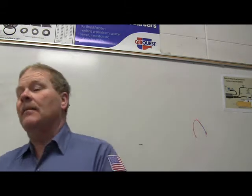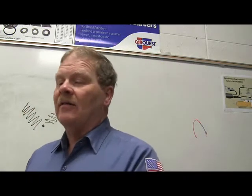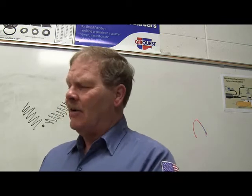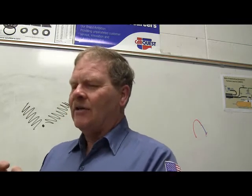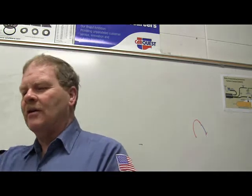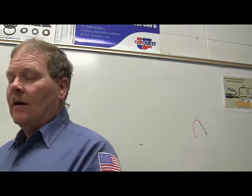Now, listen up. The magnetic gauges don't have instrument voltage regulators. Some of them may have a little resistor or something on them. And a lot of times you can take your test light and hook it to ground and touch the wire going to a magnetic gauge, and if that light lights up a little bit, you do know you got a good circuit all the way back to your gauge. You know, occasionally you'll have bad gauges.